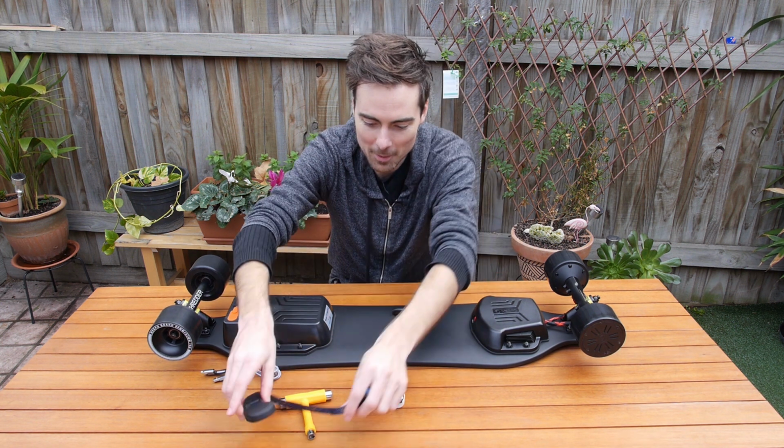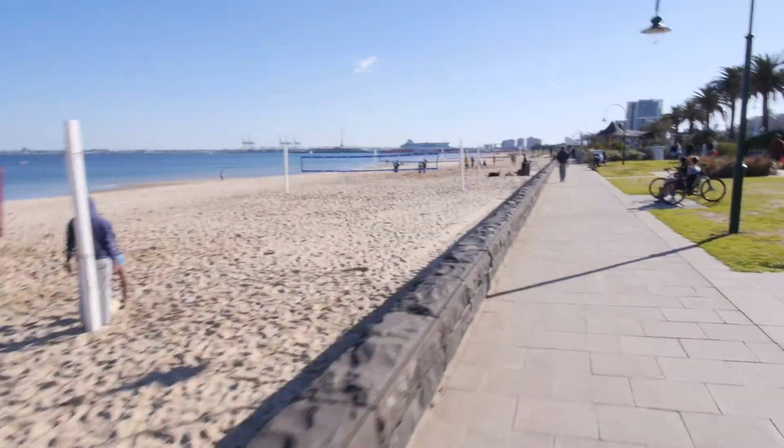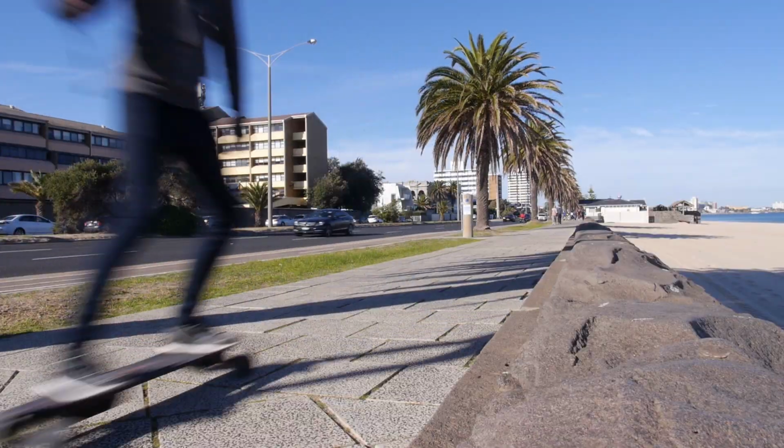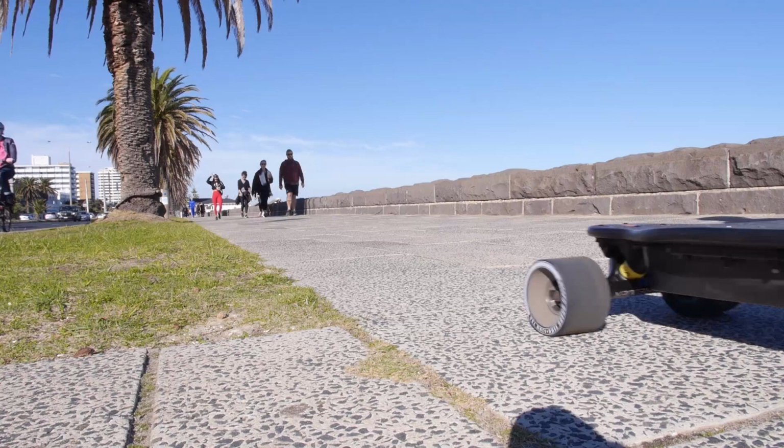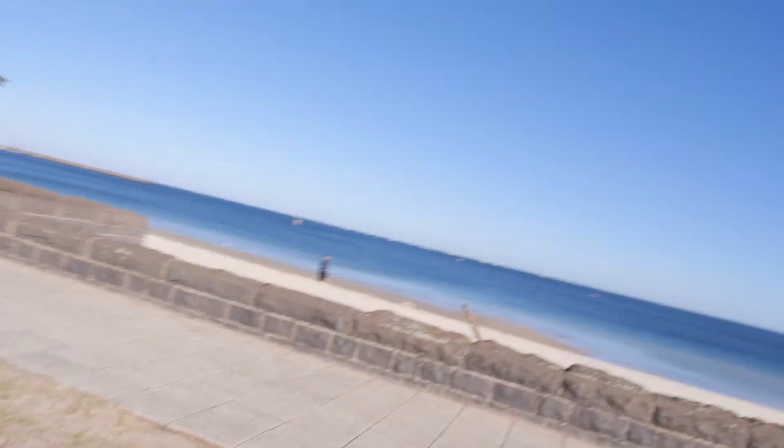All right, this is probably the most excited I've been all month. Let's take this out onto the road. Let's walk through the settings, shall we, hey? So low, very slow, 10 kilometers an hour. Painful. I'm walking pace. Medium. Bit quicker acceleration curve. Still very manageable. Caps us out at about 23 kilometers. Very nice, very smooth, great sort of gradual beginner stuff. Like if you're just sort of starting out on this board.